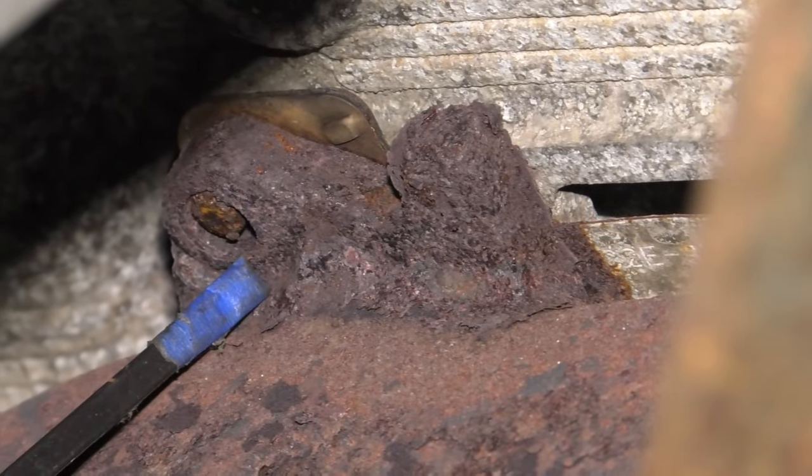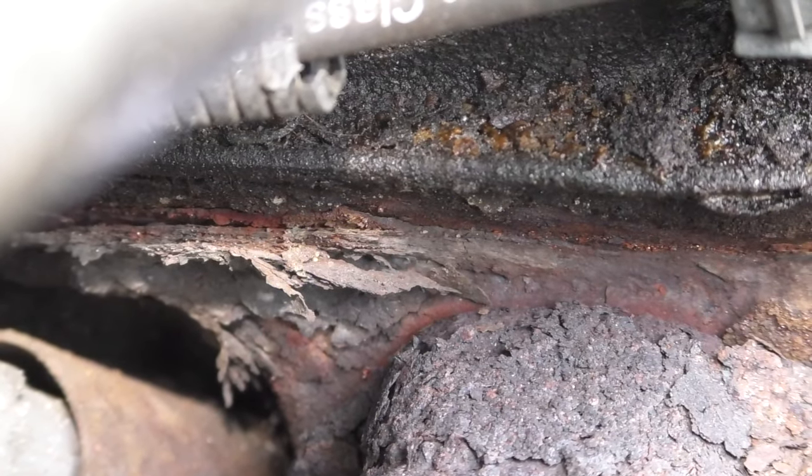For fixes: let's say you found that exhaust tick — maybe it's on the right side like on this particular vehicle. We personally have two broken studs on this manifold. If the studs are broken, there's no way the nuts are going to hold it to the engine, so it's going to create a loose contact with exhaust fumes leaking into the engine compartment. The best thing to do would be to remove the manifold completely. You might have to remove the studs or even drill and tap them. If you have to drill and tap, be very careful because the engine metal is generally much softer than the studs that go into it.